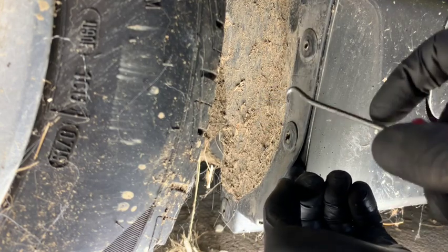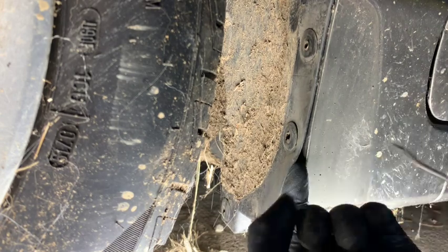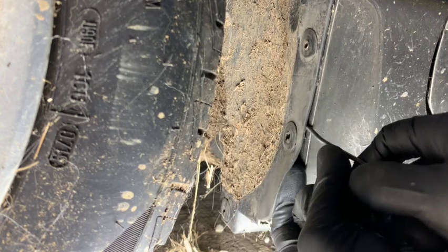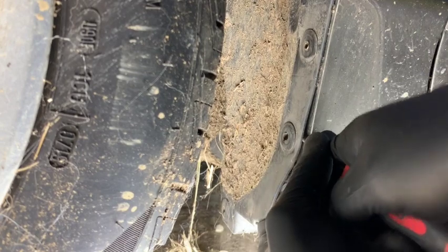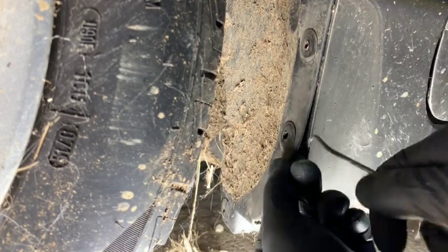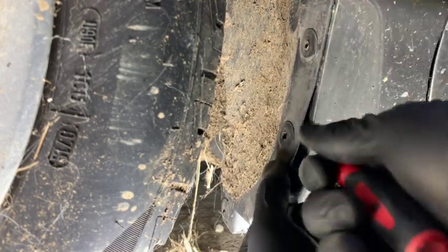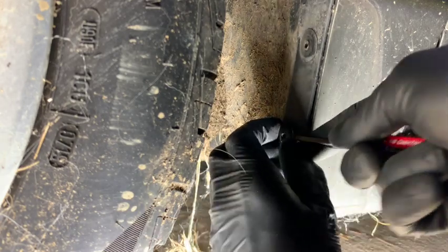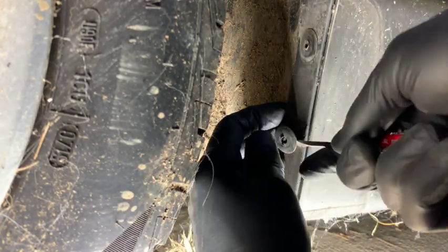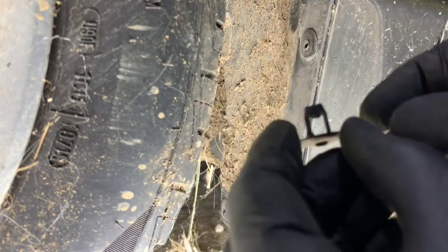When it gives, that usually means one tab is on the front and one is on the back. To get the back side, use a pick tool that wraps around so you can go around the back of the clip and pull the tab. Hold out on the fender liner — don't let it down or it might clip back in. Go between the fender liner and fender, come around the back side of the clip, and pull until you hear it give.